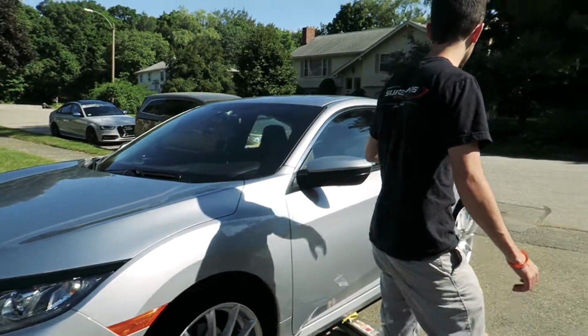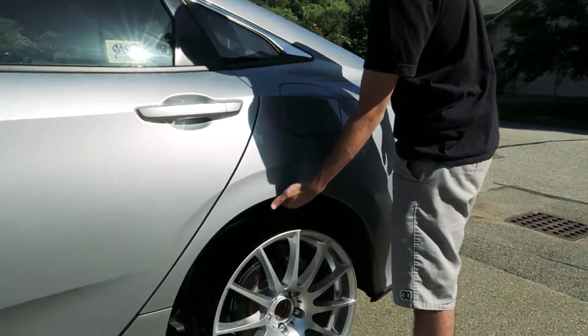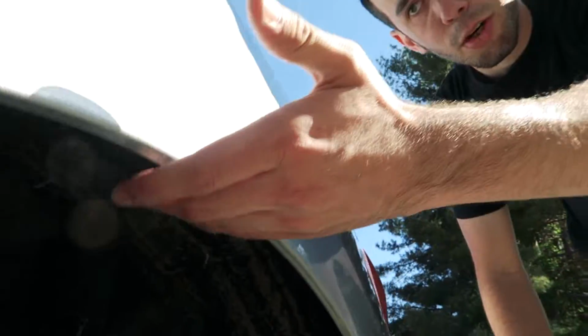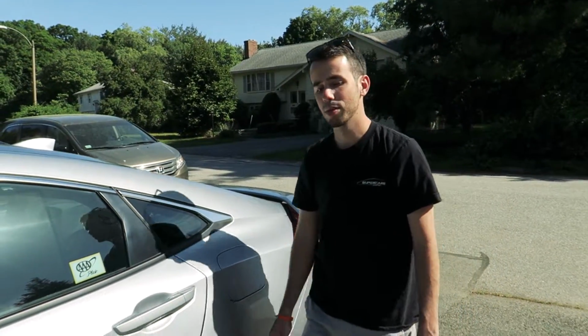The rear will be fine. The rear's a little less aggressive, and there's no plastic here. It's just fender liner. Which would suck if you had to roll it, because there's nothing to roll, but there's no big chunk of plastic. I think the front is going to be your place of rubbing. If you do rub somewhere, you're going to trim.